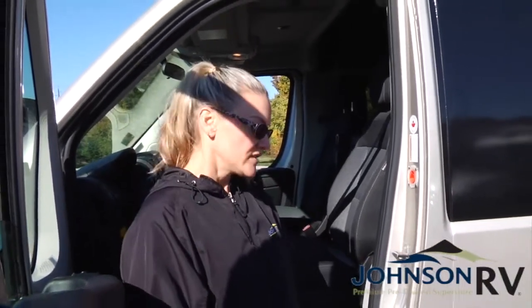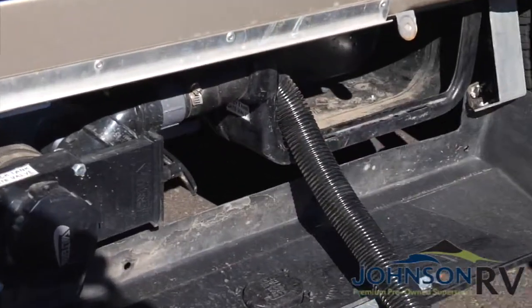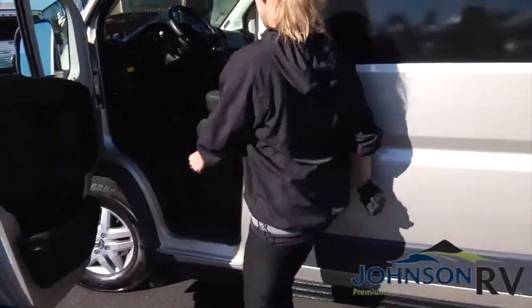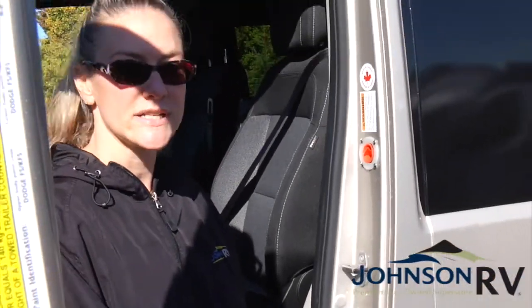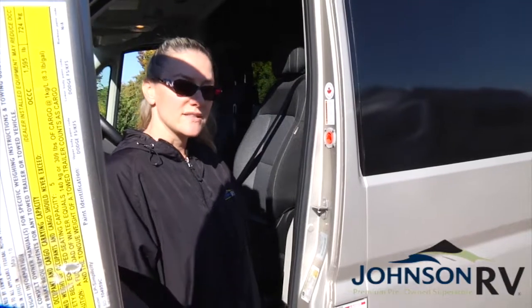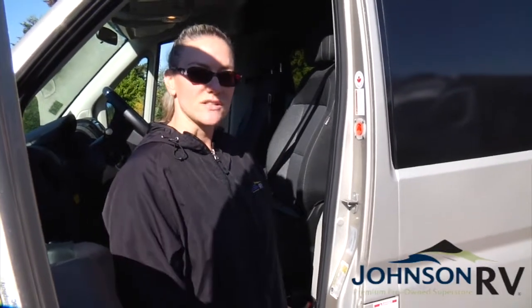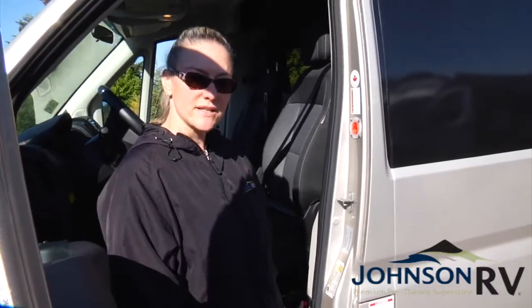You can also check to see if the tank is empty by going on the inside to the monitor panel. When you're pretty sure everything is all out of your black tank, with the black valve open, you're going to come over to the gray valve, located right here, and pull it open until it's fully extended. Then walk over to the driver's side door, push the red button for the macerator, and hold it in the entire time — again, 20, 30, 40 seconds depending on how full your tanks were. Be aware that several times you can get something stuck on the sensors, so even though you've held the button for a minute, the sensor may still show one-third full. That's probably a particle stuck on the sensor — as long as you spent the time dumping the tanks, go ahead and move on.